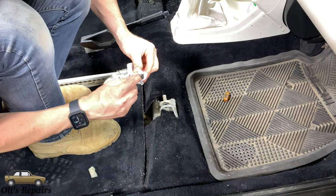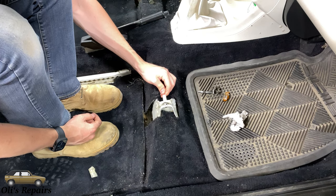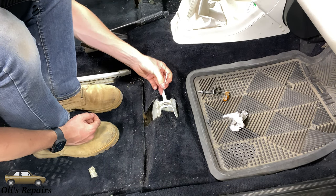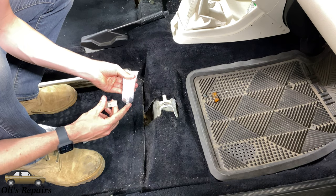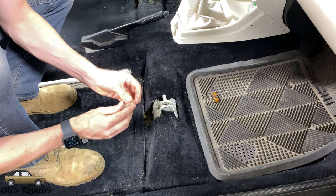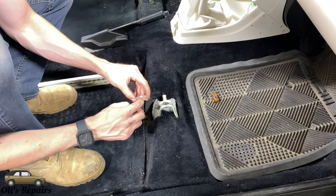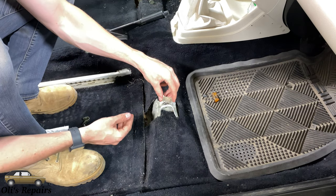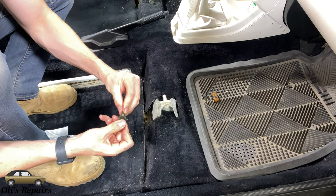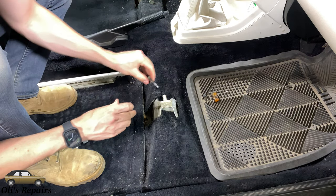People are always under the guise that more grease means more lubrication — really, it just means you're going to be collecting a lot of unnecessary dirt. It does you no good if you clean the pin but not the actual sleeve where it slides into. I'll be using a little bit of silicone grease to grease the sliding surfaces on this front slider. We can also grease this little nub that slides into the hole. Take it so these little pieces that point downwards will point down, and where these two slits are, this will be on the top — just slide it in place. Apply a little bit of silicone grease to the shaft of this little locking rod, and then wipe off the extra and slide it in place.